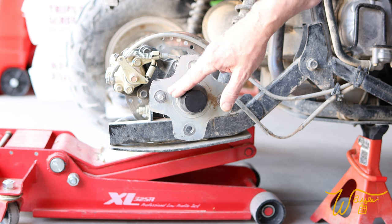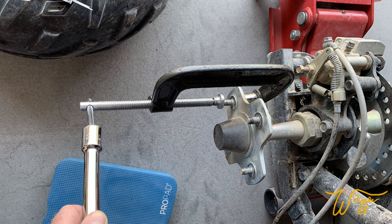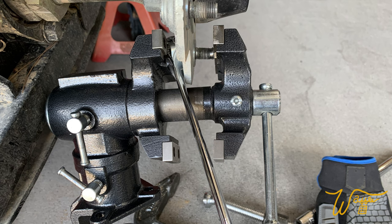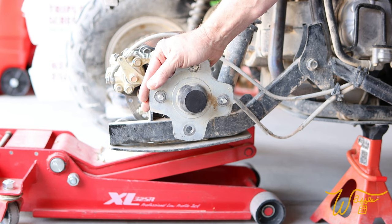What's the best way of getting these wheel studs off? I looked on YouTube and saw three methods used on other UTVs. I tried all three, and only one worked for us. First, I tried a C-clamp with a socket on the other side, but the pivoting part kept falling off repeatedly. Next, I tried a little benchtop removable vise — it was pretty stable, but it required more force than it could handle, and it actually cracked the head of that poor little vise. So eventually I had to resort to the one I was trying to avoid.